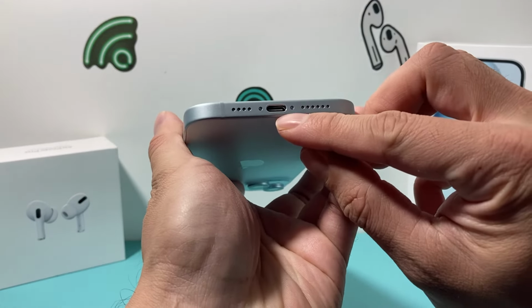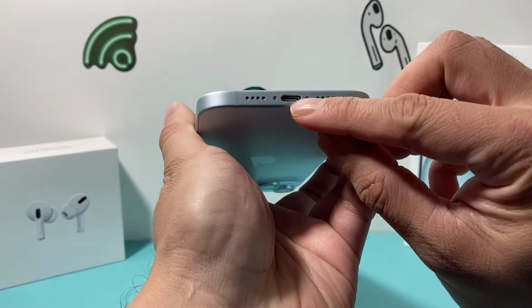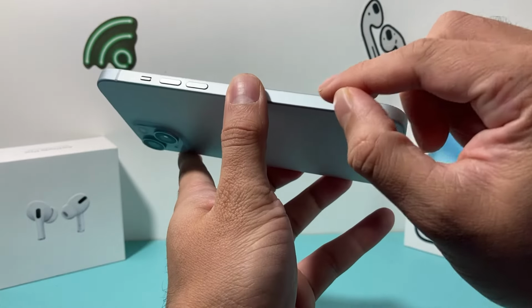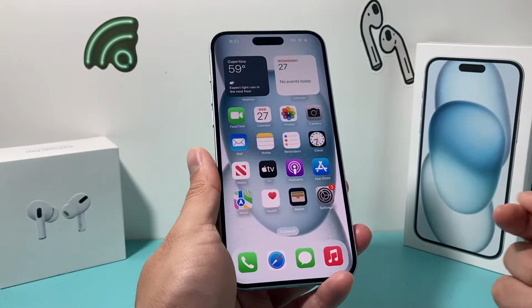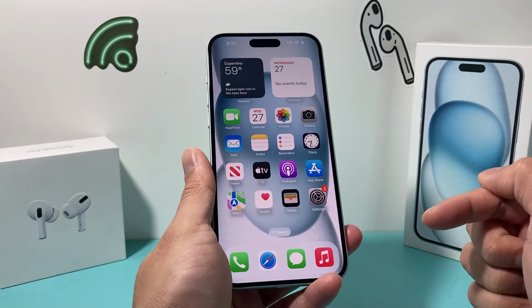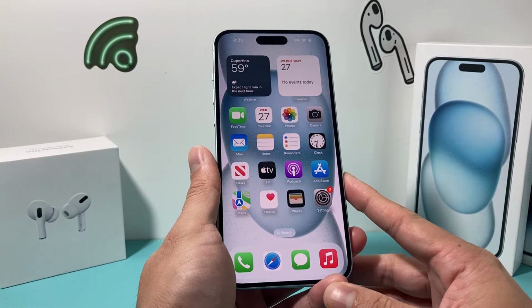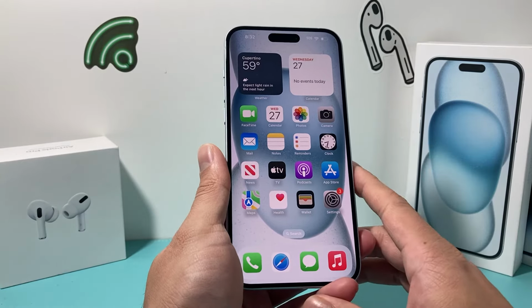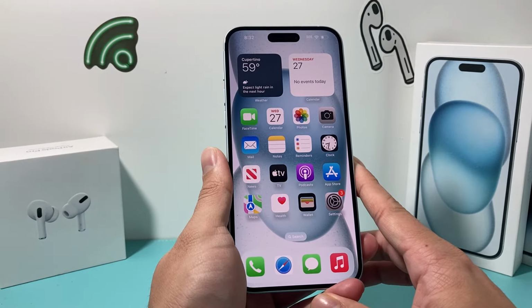There's some indicators on the charge port. If it turns yellow or red, it will indicate that it's been water damaged. Now, if you have a SIM card tray, you can also look under there as well, which we explain in another video, and we'll leave a link for that in the description section if you want to check that out, on how to check if your iPhone really did get water damage or not, because that will determine if Apple will cover it or not.